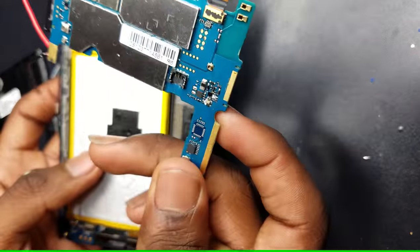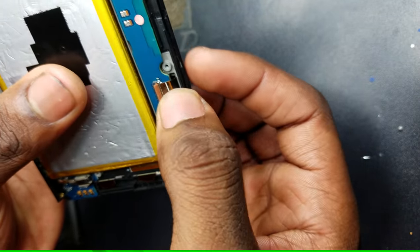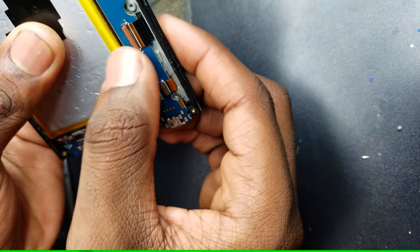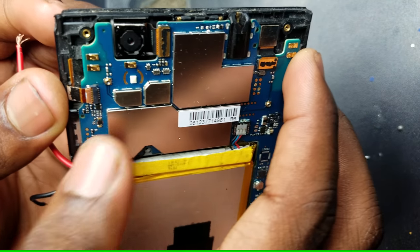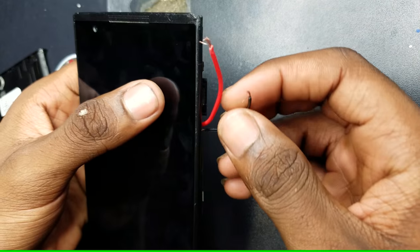Place the motherboard back into the chassis of the phone. Reconnect the LCD and touch button's ribbon cable. Now finish them all by closing the latches. Repeat the same process for the digitizer. Do not reassemble your device unless you've tested it and are satisfied with the results.